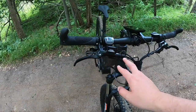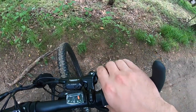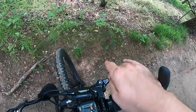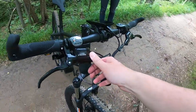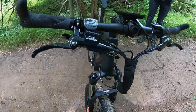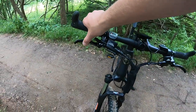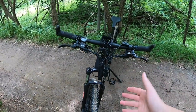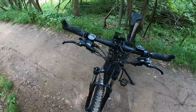The brake levers — I'd call these a three- to four-finger brake lever. They're nice and long so you can get a good grip. They do have the electric system inside of them — that's part of the name convention where they're called the Tektro Auriga E-Comp. The E-Comp is for their electric cutoff switch that runs through the brake lever housing into the controller. When you pull on the brakes, it sends a signal to cut power to the motor so you're never using the motor while trying to stop. It's a safety mechanism that's quite common.